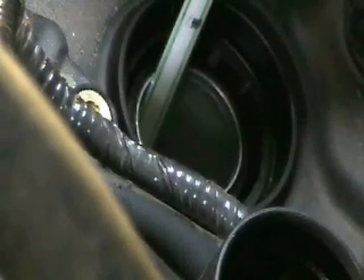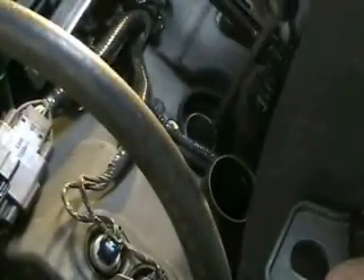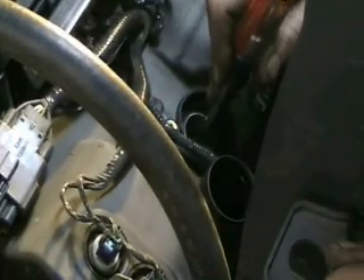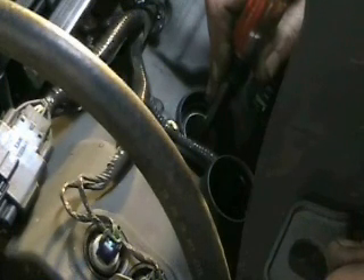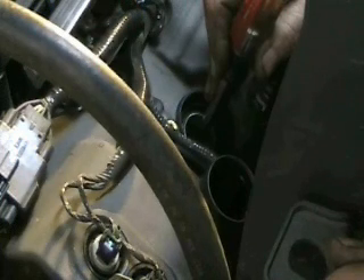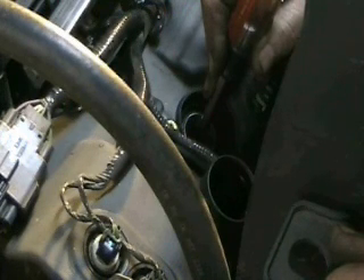The piston is on the downward stroke, so I can now do my test. I'm going to take this screwdriver, put it into the spark plug hole, and feel for the top of the piston. I am now resting the screwdriver on the top of the piston. I don't want to push down yet. I'm going to push down kind of sharply and listen for any sound and most importantly feel for any movement at all of the screwdriver. There will be quite a bit on this one. Be very, very quiet — I'm hunting for rod knock.